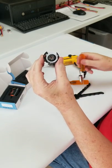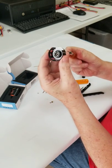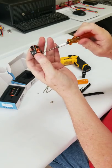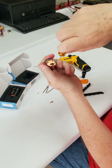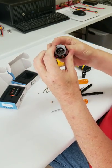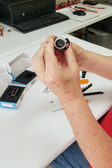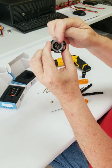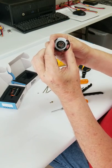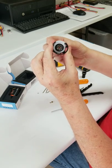We can control the timing - I'm going to show that on the back of this timing cover there are three black screws. We're just going to loosen those up - that's a 1.5 millimeter - and you can see what happens now when I rotate: you can see that circuit board rotate. This is what we're doing when we're changing the timing - we're changing the relationship of that little electronic board in relation to the rest of the motor. This is what adjusts the timing mechanically when we're setting the timing inside the motor.